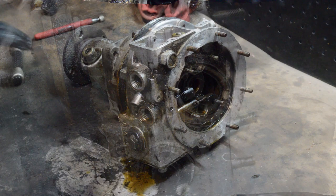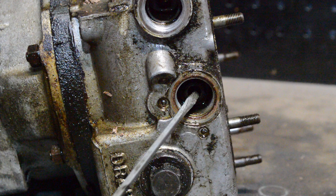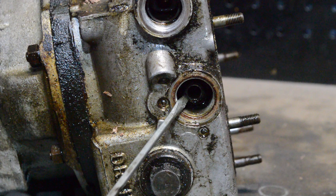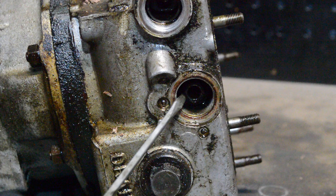In here is the oil pump housing for the overdrive — it's the center plug, this is what we just took everything out of. There's a special tool to take this out. The shape is basically a circle but it's flat on two ends, so think of it like a squished circle, and what you need is something to pinch in and unscrew it. What would work great is a wrench, but you can't get a wrench on it because of the pin, so you need a socket that will work that way. I'm going to attempt to make a tool because most of us don't have the appropriate Churchill tool for this.